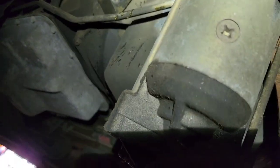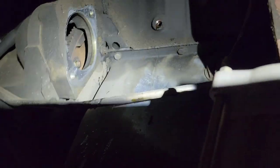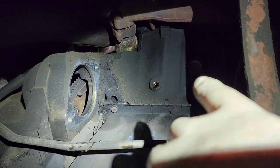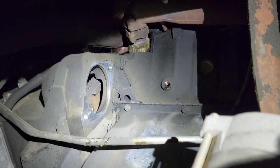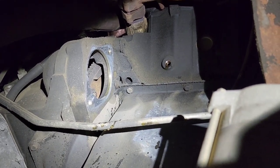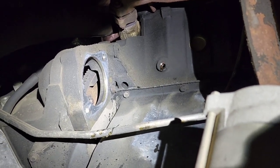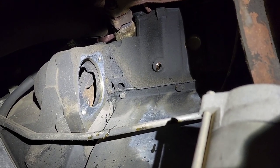Here's the passenger side — you can see the starter hanging down. Luckily this is an older one so it's just two bolts; later ones have three bolts. There's the block drain right there — it's just a quarter-inch drive socket to take it out. You've got to drain the block because if there's any fuel left in the block it will just make its way to the bottle and stay in the system. I've got the whole cooling system drained, so now I'm going to pull the cups, and after I replace the cups I'll put the water pump back on, fill the cooling system, drain it, fill it, drain it, and use degreaser to get as much fuel out as I can.